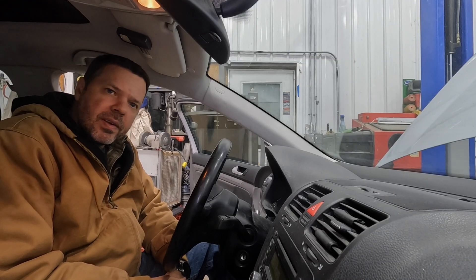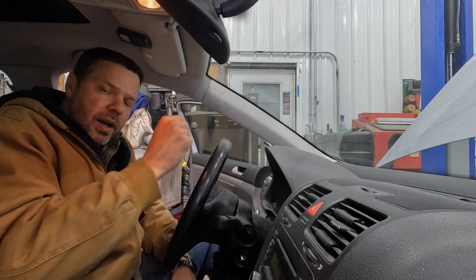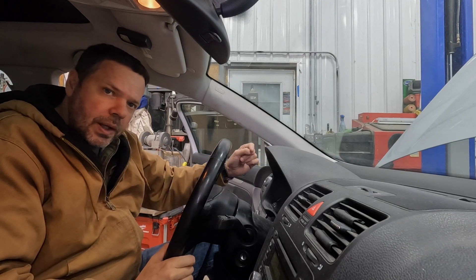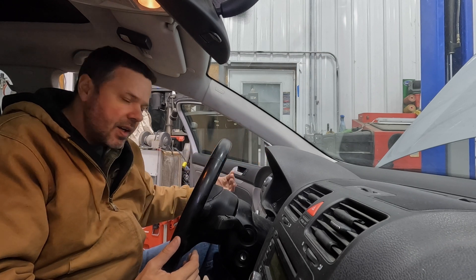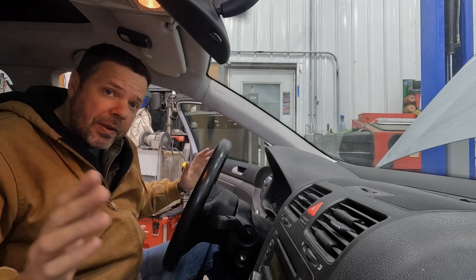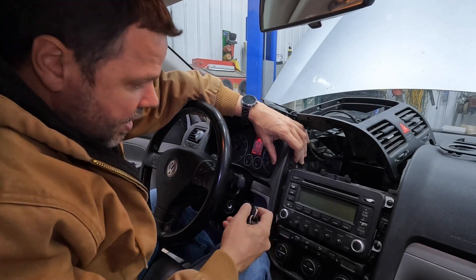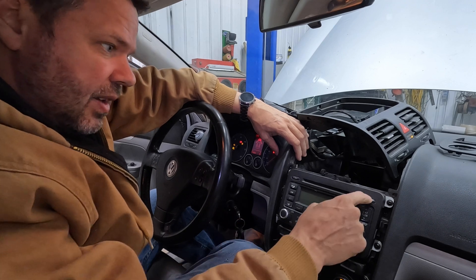Welcome to my office for the next 10 or 15 minutes. Typically, since this fuse did actually say it's specifically for the radio, I've had it in other vehicles where it's a bigger fuse and it goes to a relay to the fuse panel in the cabin — in that case you just repeat the process and pull fuses in here too. But you've got to remember, with the doors open that draw is going to go up because the dome light is on. This radio has four screws. Before you pull it, if you have a disc changer, get your discs out first.